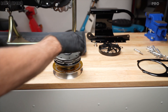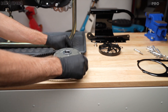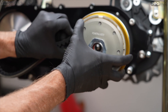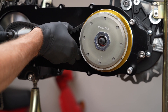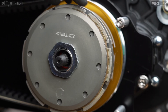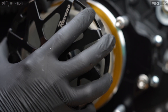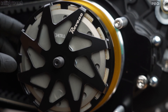Now we've got to get our belt on. The way I do it is I push the clutch down on the floor and squeeze it, then with the other hand put the belt down in there. I'll do that quickly and then come up and put it on. Slide it in — I'm holding it down until I get it in there. See all these little clutch teeth? Those have got to be lined up. You don't want to put it in and crank down and bust one of those clutch plates. It's pretty obvious when you get it.